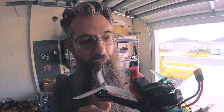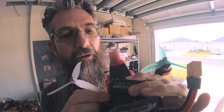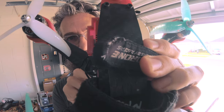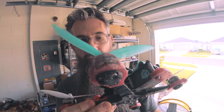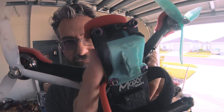The other thing that would really help would be to not have the cable on the side. Speaking of that, that's part of what I did with this mount — I've got this little cover here that keeps the wires routed down underneath, so the plug goes out and the wires stay up under that cover, keeping the cables from getting jerked or pulled on, protecting them and keeping them out of the props in hard crashes. Also, the way this camera mounts on the front — it's got these little TPU mounts because of how the Moxie is designed — that protects the camera from a lot of jarring. Those things really make a big difference in durability.